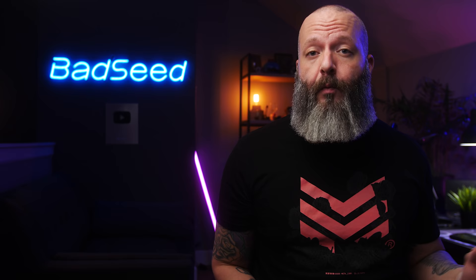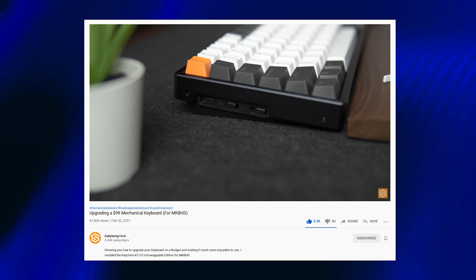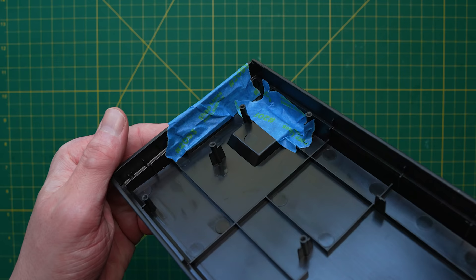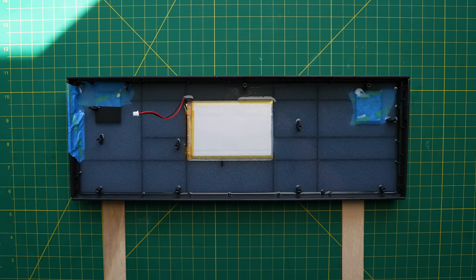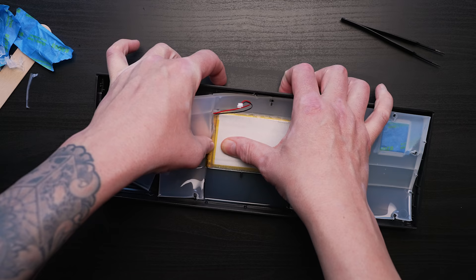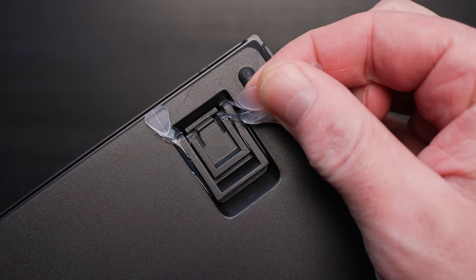You can attack case dampening a few ways — the cheapest and easiest is just some packing foam. I use Sorbothane sometimes, but it's about $25 a sheet on Amazon. This time I opted for a simple silicone mod after seeing a Daily Setup text video on the board he did for MKBHD. I grabbed the silicone off Amazon for about $16. You just level the board, seal all the openings, mix, and let it sit for about an hour and you're good to go. After getting the mix in, it's clear I could have used about 50% more to avoid an ice cube tray effect, but that would have driven the cost well above what Sorbothane would have cost. I left the battery in place so I wouldn't have to trim around it — it's a big 4,000 mAh battery, so battery life is never really an issue. Outside of a little leakage on the case, this worked like a charm — took about an hour and a half.